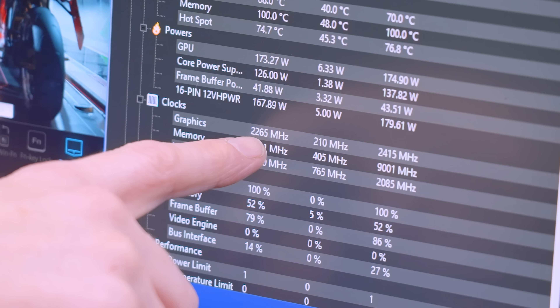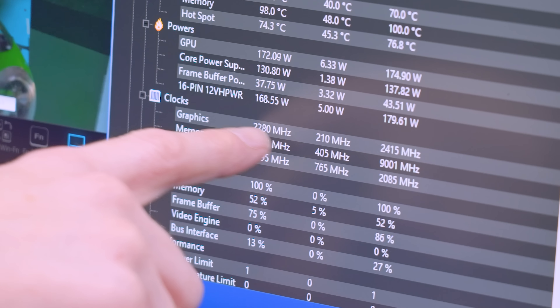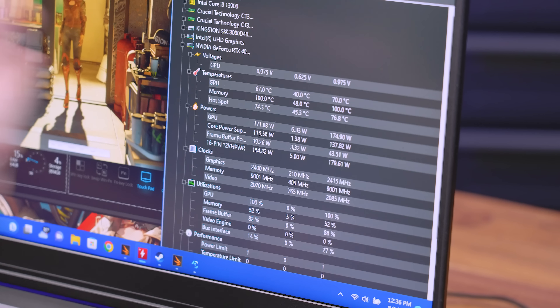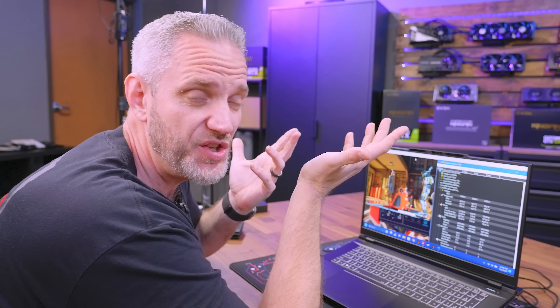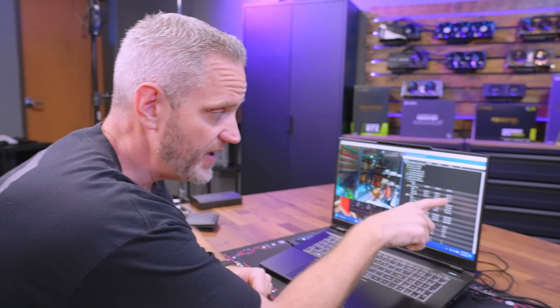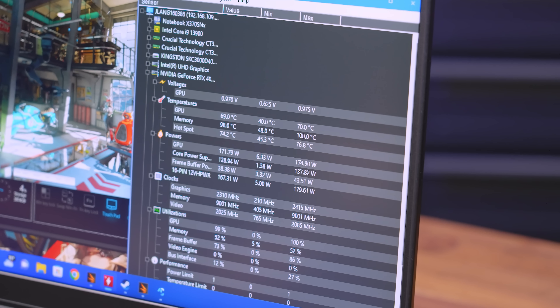The graphics clock is bouncing between the low 2200s and hitting 2400 when loading scenes — this is where the frequency has always been. We did find out the spec sheet says 95C, though that might be for desktop GPUs; the memory may be rated a little different in laptops since they run hotter. At 100C, we're not seeing anything slow down. Falcon Northwest has talked with NVIDIA and it's been explicitly stated that these are the targets — it's designed to run this hot. We know that, but we don't have to like it.